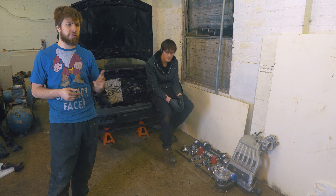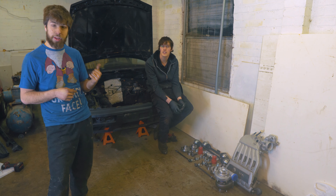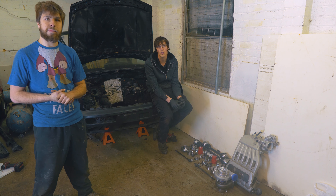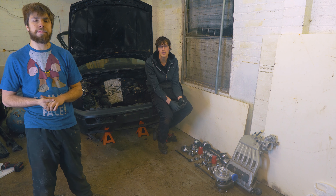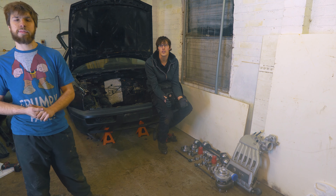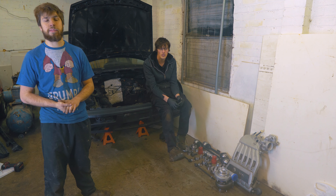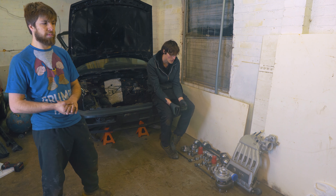The A3 does run — we've got the engine that's coming out of it — but I don't think we're going to use that one as-is. It needs a timing chain done. It's got around 86,000 miles on it but very poor service history, and we believe it's got a stretched chain due to camshaft correlation faults, and it is quite rattly. So we've got a new timing chain kit on the shelf ready and waiting — as soon as it gets pulled out we'll probably do a video of throwing that together. Then we need to source a clutch and flywheel kit for it.